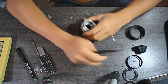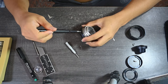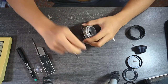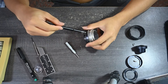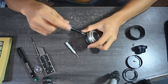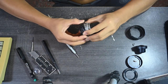Once you unscrew this guy, you wanna unscrew this guy. I think it has three of these screws here on the side. And also what I found out is that if you have a good Phillips bit, like this media kit, these actually work quite well on JIS screws. If you have a rubbish screwdriver, then you're just out of luck. You can damage your screws and stuff like that. This then should come out somehow.